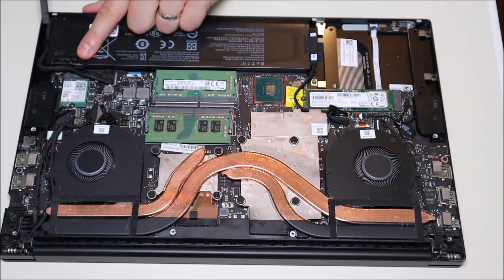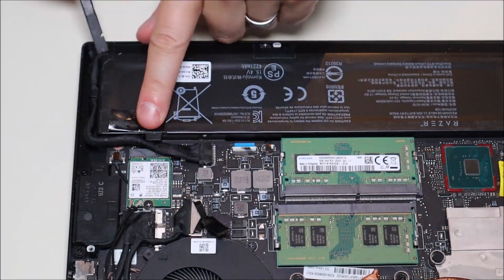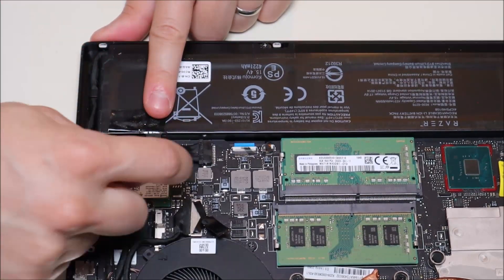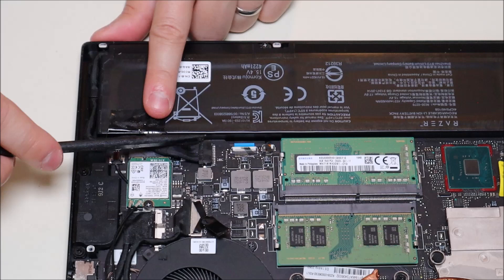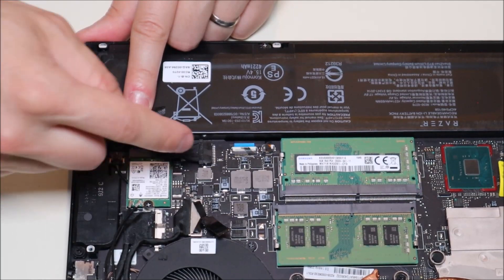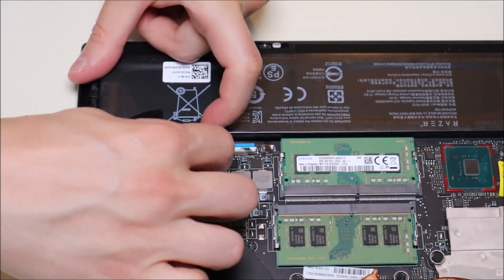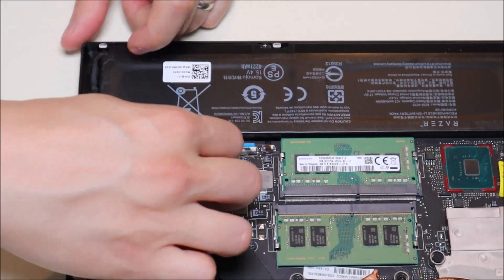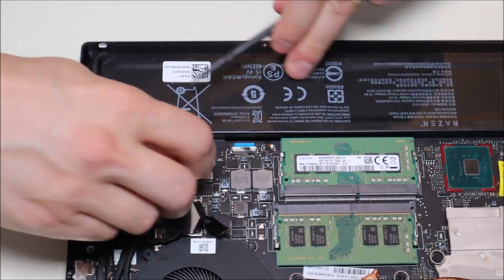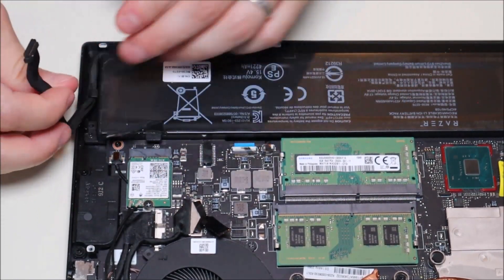This cord runs out of the side here — I'll zoom in a little for you. This battery cable runs inside that fitting and plugs into the motherboard. I'm going to take my fingernails or some plastic pry tools, put them on either side of the plug, and just pull it out. Don't pull by the wire ever — the wire can come out of the plug. We want the wire and the plug to stay together. Just walk it out with a little wiggle, and that's how you unplug your battery.